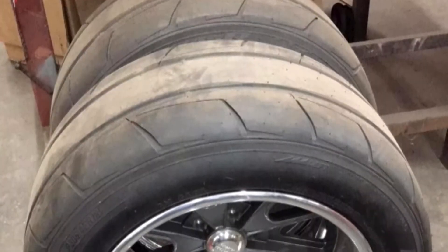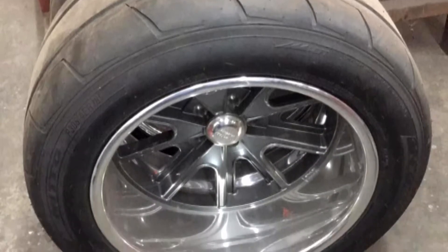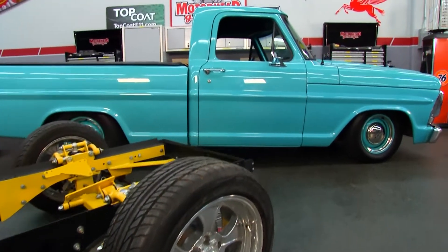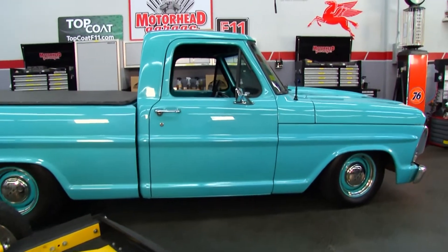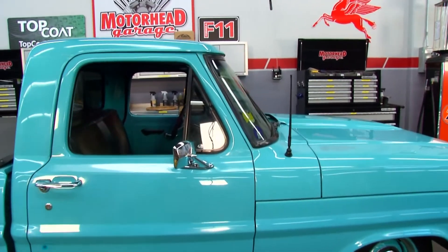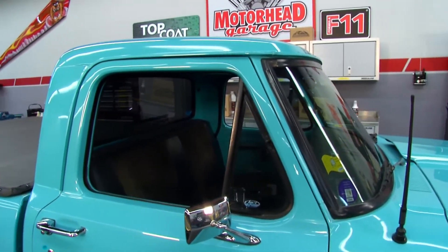When you started going from skinny nylon bias-ply tires and you started putting wider radial tires with some serious grip on it, then the deficiencies of the suspension really show up. And when you update everything else on the car — the tires, the engine, and all that — you need to update the suspension because you overwhelm its capabilities. Do you think the chassis and suspension sometimes get overlooked when upfitting a car? I personally cringe when I see a car with a big motor and fat tires and a stock 1964 suspension. There's room for improvement.